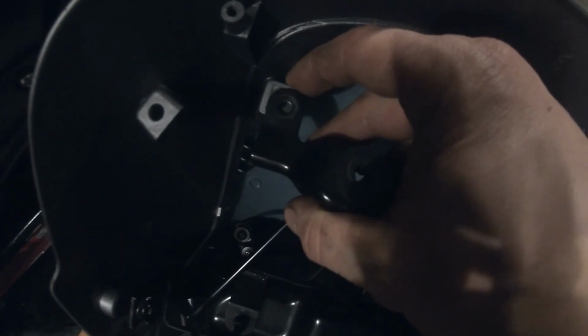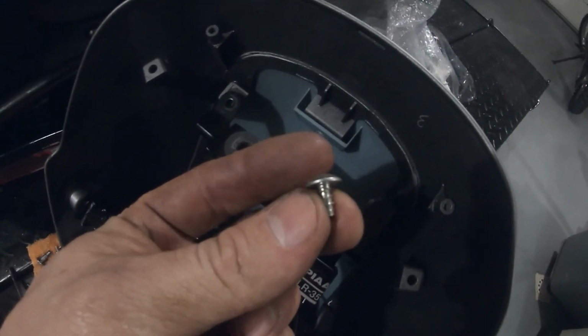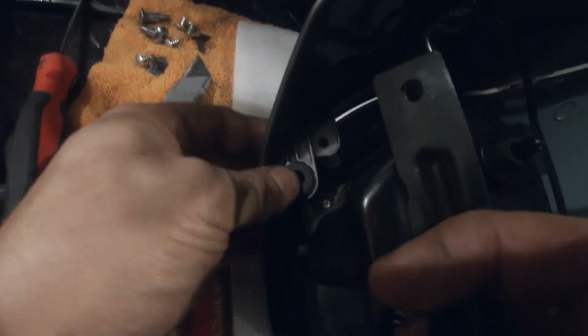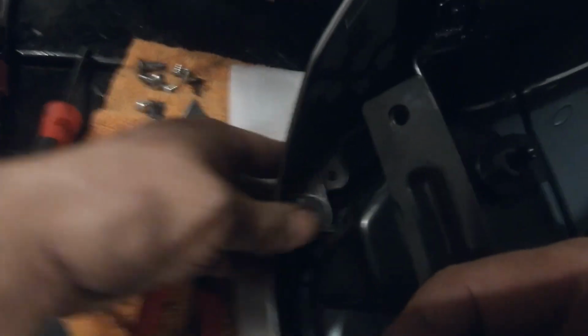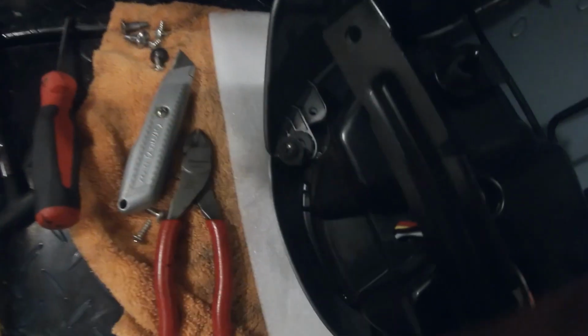Now we put the outer cover back on. And remember, this upper part, these screws got to go in before your tachometer. They just have some metal clips in the back of them. They go underneath, obviously. And then they use these short Phillips head screws. One goes there and one goes there, and then you're good to put your tachometer back on. And down here, obviously, if this slides in, there's a bunch of tabs on the sides. Make sure those are put in properly on each side. And again, the black screws are the ones that go here, and then the short screws follow suit down there.